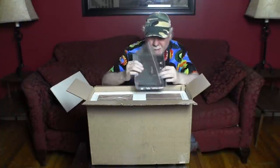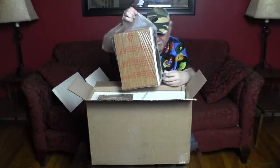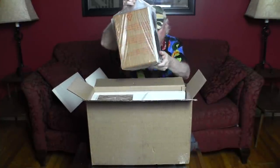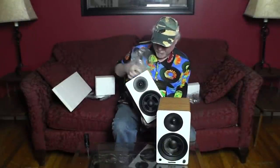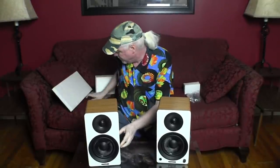When I was taking them out of the box, I noticed how small they were — I didn't think they were that small when looking at them on videos. I also noticed that they didn't have a tuned bass port. A bass port is a hole in the front or back of the speaker that changes the resonant frequency of the cabinet, so the speaker thinks it's in a larger enclosure and can produce more bass. These don't have them. So I was thinking, okay, I'm probably pretty familiar with how this is going to sound. I've heard lots of small speakers and they sound small. However, when I hooked them up, I was pleasantly surprised.